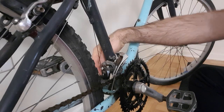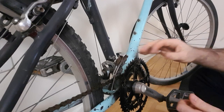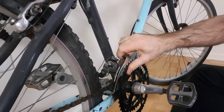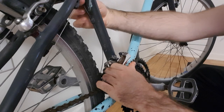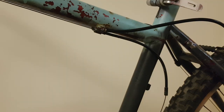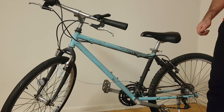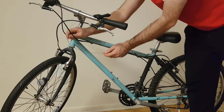That cable over here connects to the derailleur down here and comes up through this cable stop and into a piece of cable housing. There's no way of disengaging a derailleur, but what you can do is shift it into a different position to give it more slack. If I take this arm for the front derailleur and pull it out away from the bike, it creates some slack in the cable. With that slack, I'm able to use my hand to maneuver this piece of cable housing out of its cable stop. Now with one end of that piece of cable housing free, I can grab it and pull it back, and the front section of cable housing can also be taken out quite easily. Just like I demonstrated for the brake cable, I'm able to take this front section of cable housing and slide it all the way to the back, which will expose the front section which you can apply lubricant to.